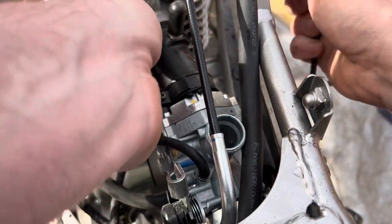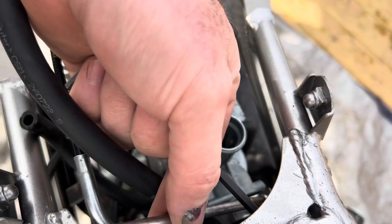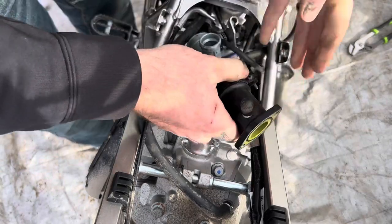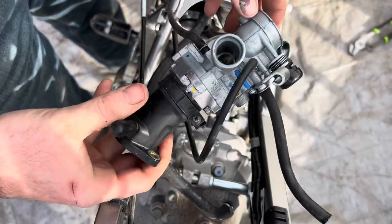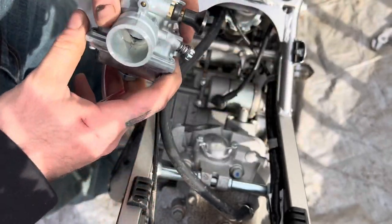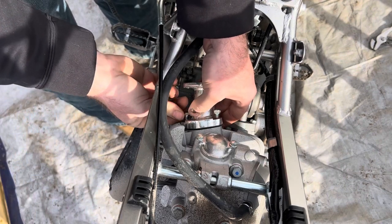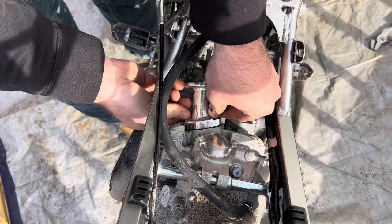We're going to take the bolts out of the head for the intake boot — these threads feel super long, I don't know why. Let me pop the carburetor out. I hate this carburetor; it has given me nothing but problems since I bought it, so we're just going ahead and thrashing it. You can't adjust it, you can't do anything with it. Here's the new one — I'll leave all the specs in the description below. The kit from T-Bolt comes with a new intake, bolts right on, and includes all the hardware.